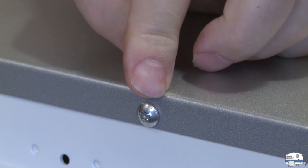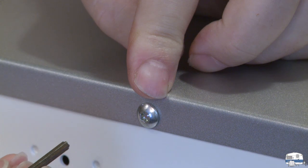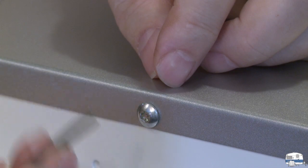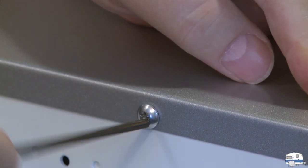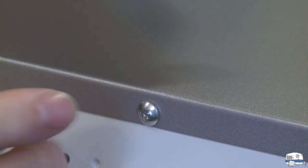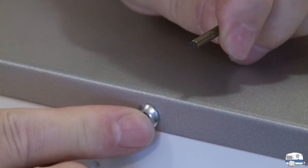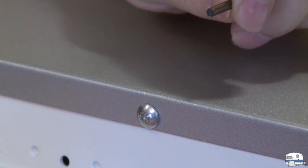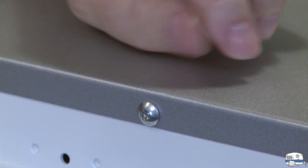Here's the problem with the screw. I've got a spline wrench — I have these because I used to fix IBM typewriters, and there was a time when IBM typewriters were all put together with spline wrenches rather than Allen wrenches. But it won't go in because there's a little tip inside, so what you need is a hollow spline wrench. They don't make it easy because they don't want you to do it yourself — you'd have to pay a technician maybe 60 to 120 dollars an hour to change a light bulb.